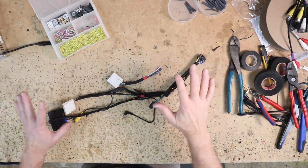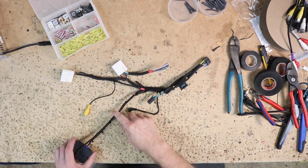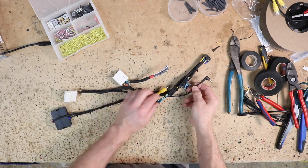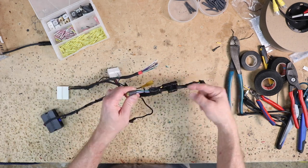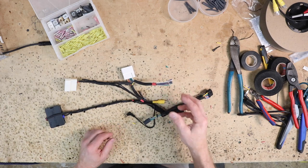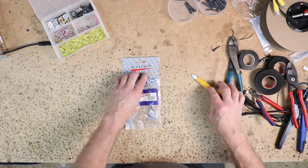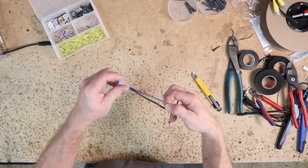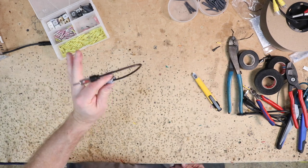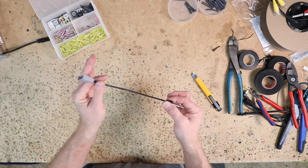The harness is all set and done. Let's go through it quickly. The backup camera retention is located here, the main power is here, the steering wheel control will plug into this extension cable — long enough for the Alpine. The steering wheel control plugs into the back of the radio. The speaker wires are all insulated and capped off; these wires are what our amplifier will connect to. The harness is all set and ready to get into the car. The last piece of the harness puzzle is the antenna adapter, which is the BAA36. Initially looking at the radio, we saw it did not have this turn-on — this just pulls out and now this is all set and ready to go into the car. Since it's a standalone simple thing and we still have some work to do on the radio, do yourself a favor and go plug it into the car right now.